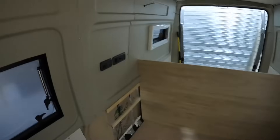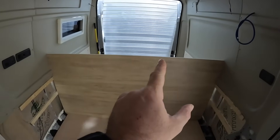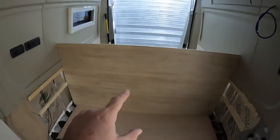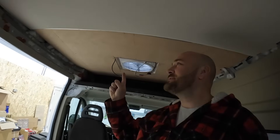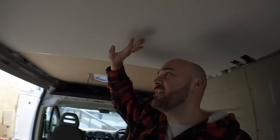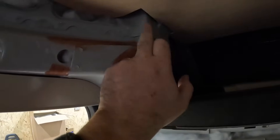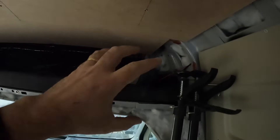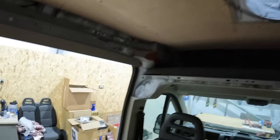I've just come into the room now and I can already see the dust — it's such a fine dust, it gets everywhere. Right — those two templates have been put onto the board and it's been cut. This is the total height. There's a kitchen area here and a larder here, so we're going to do a cut-out here — like a dip, 100mm down. I'm also going to have a cut-out here for that sliding toilet, but I'll leave that a second because I've still got a ceiling panel to do. The one bonded nicely last night — that's lovely — and we're just on the bench cutting this one. We've got a couple of funky scribes to do around this section, and this side is completely different again. I've still got the Solway B-pillar top trim to put on there, and a cut-out for the MaxFan.